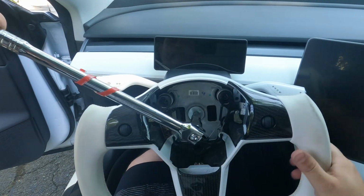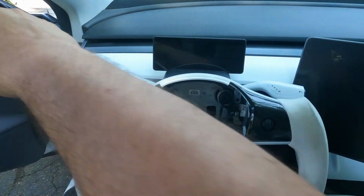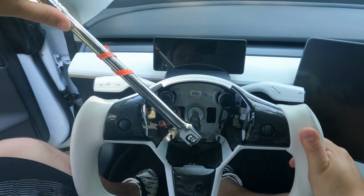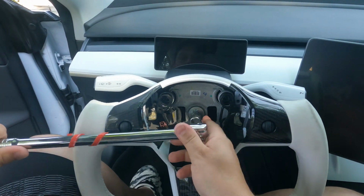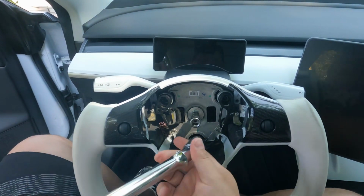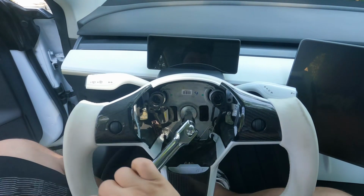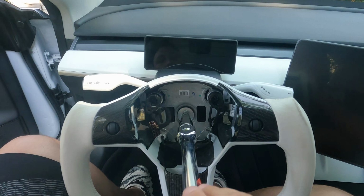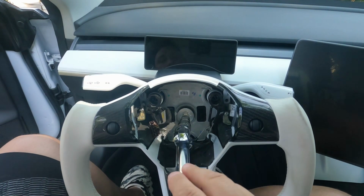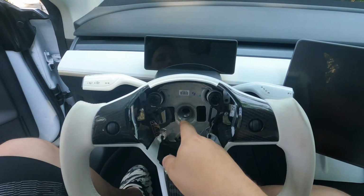And you're going to apply downward pressure on that bolt. Just take your time here. It is very, very tight. And don't be surprised if that bolt or the breaker bar comes free. It happens to me all the time. But now the breaker bar has worked, and with this one in particular, it has the articulating head, so I just rotate it to get the nut free from the steering wheel. So there's the nut. You can see the yellow Loctite on there.